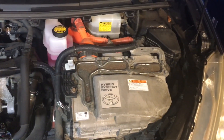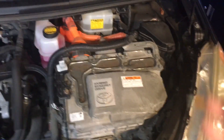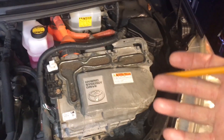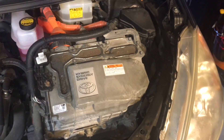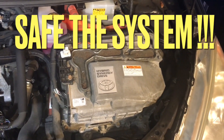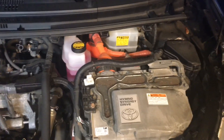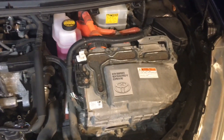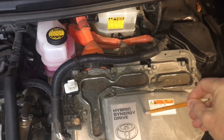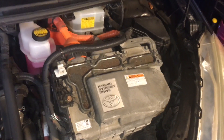In the event that there was a weekender or shade tree mechanic who didn't understand the hazards a hybrid or electric vehicle could offer, it will provide protection to the uninitiated by opening the high voltage circuit to protect the system. The battery in this particular version of the Prius has a nominal voltage of 144 volts DC, and the capacitors inside and the boost converter can step that up to a maximum of about 520 volts DC.